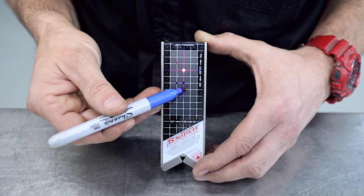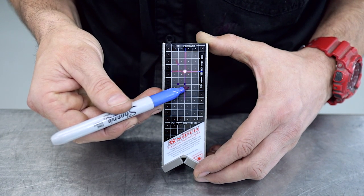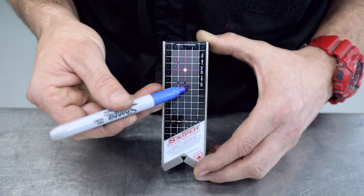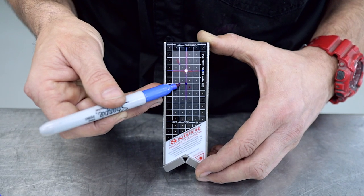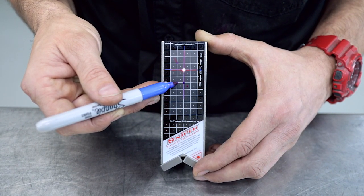It's very rare, if at all, that we run toe in. Try that at your local track — if it works for you, excellent. Otherwise, if you don't know any different, you can set your go-kart up on the first line with toe out.